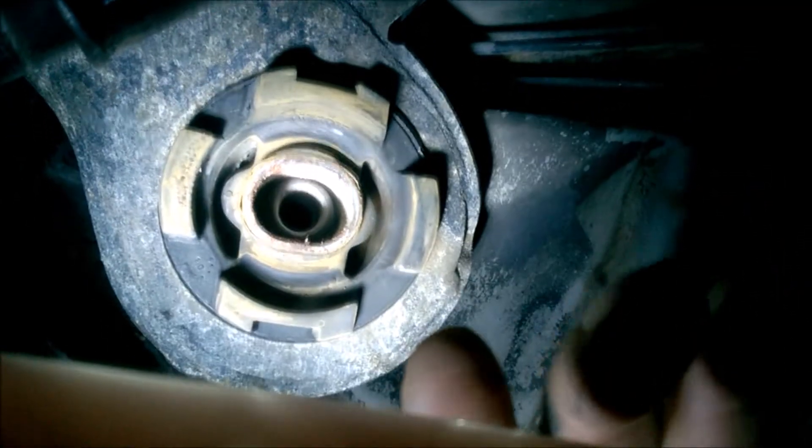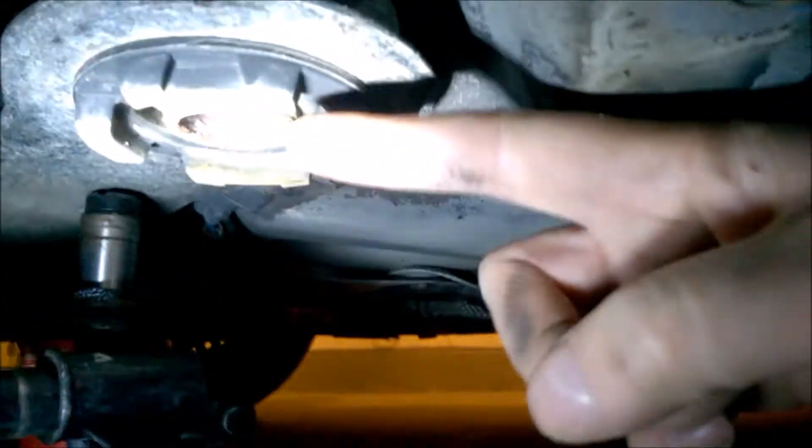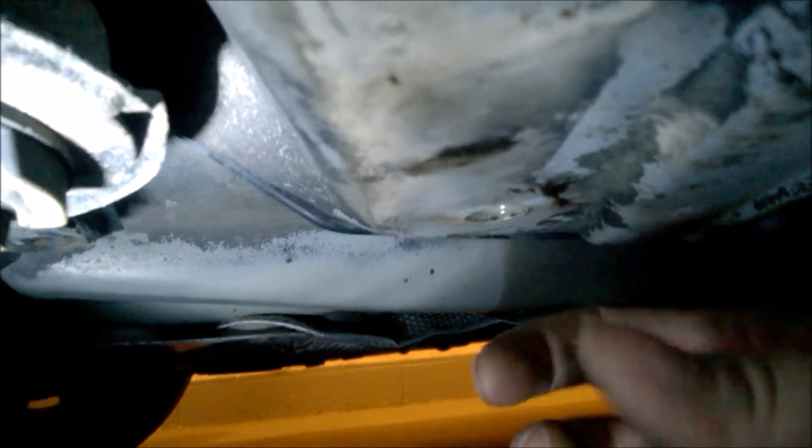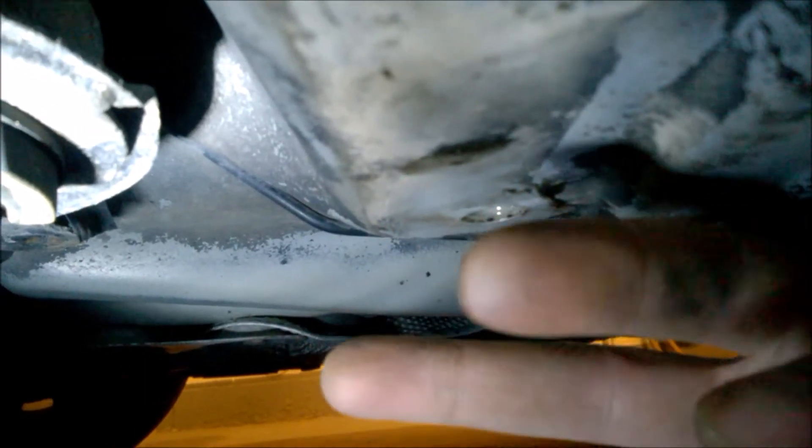One thing to be aware of: there are two bolts at the rear here and one big one. These, especially the inner bolt, may just get some water and grease on them. You really need to keep them clean because you need to tighten them properly, otherwise the bracket will move and will make a knocking noise when you brake at low speeds.